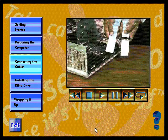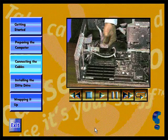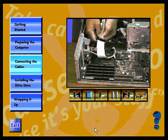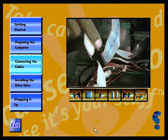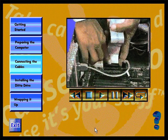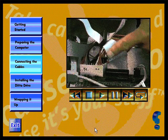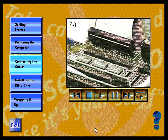Pick up the tape cable that you just unpacked. Now plug in the floppy cable to the extra plug on the tape cable. Make sure the striped edges match on the floppy cable and tape cable, and then plug them together. Now plug the tape cable into the motherboard using the two-connector end. Make sure you match the striped edge to the same side as the floppy cable you just unplugged. Also, make very sure that no pins are showing on the motherboard.